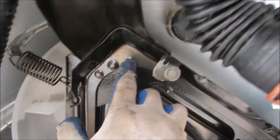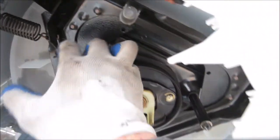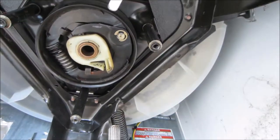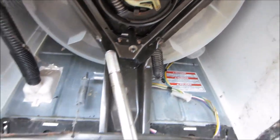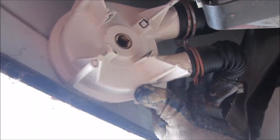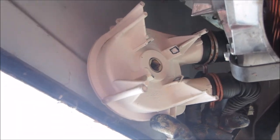You can check your base pads here — on the top sides of these there's a plastic skid, I believe it's called a base pad. Make sure all three of those are in good shape and your springs are all in good shape too. If your machine is leaking, check your water pump first. If you see a mineral trail coming down from that center hole — a telltale drip sign — then you need a new water pump.